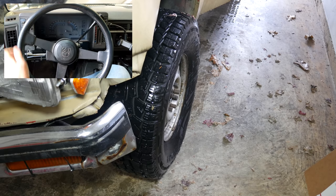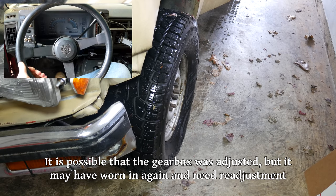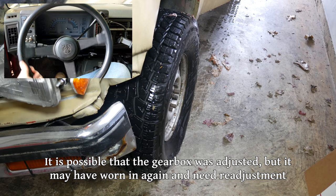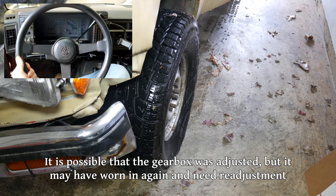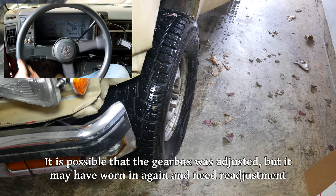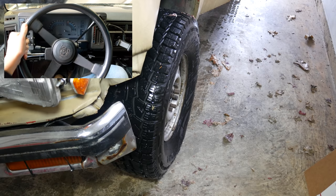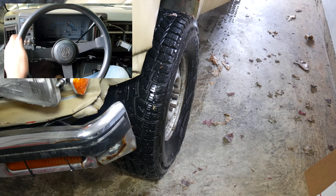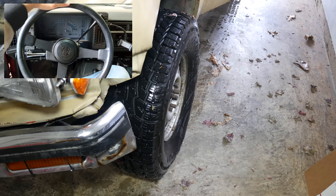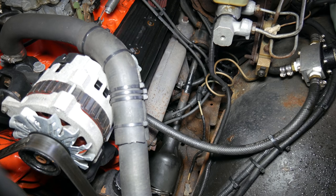Our recently installed, remanufactured steering box. They're supposed to be set up optimally from the factory, but it seems like in the future we'll have to give a go at adjusting it ourselves to hopefully make it a little bit better. But at this point, it appears that even our remanufactured unit is a bit worn out. What we'll do is go ahead with our steering shaft replacement plan, since it still is an upgrade, and it'll clear things better, and I don't know, we're kind of committed to it at this point, I guess.